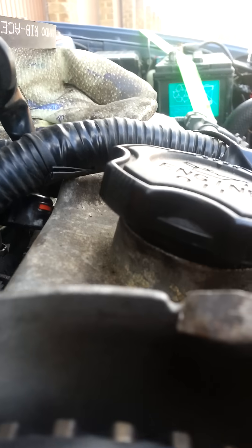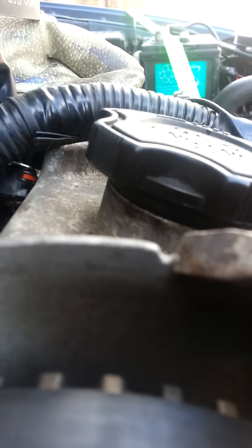At the top you get a letter E. That one has to face to the top, along with the groove there. It has to line up to that groove there on the top of the timing case.